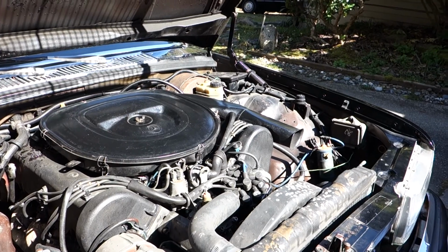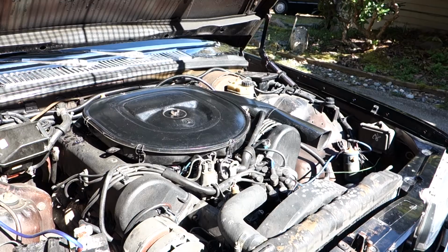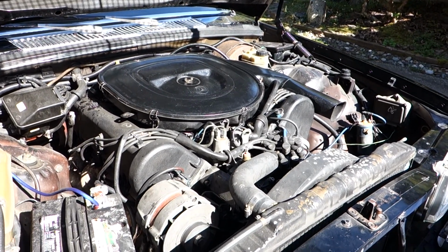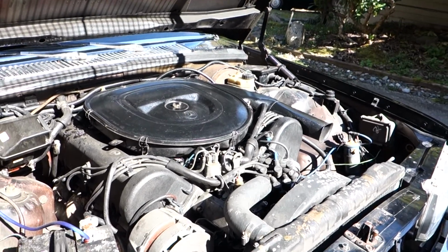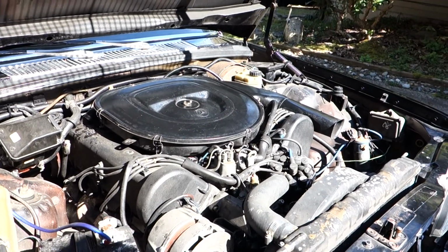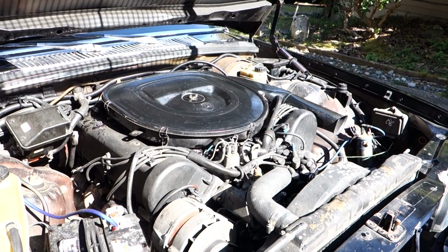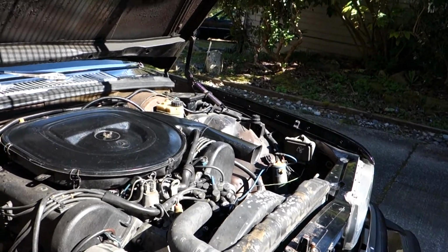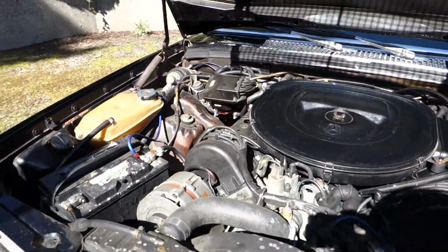Wasn't this originally designed to be a truck motor? Is it 6.9 or? This was a derivative. It's the third derivative. This was what came in the old 600 Pullmans, the limo. Originally it was a 6.3 liter, and it didn't have the dry sump. The dry sump was only later for the 6.9, because it arrived for the 600 Pullman. There were two different wheelbases of that limousine. Those, of course, go for crazy money nowadays.